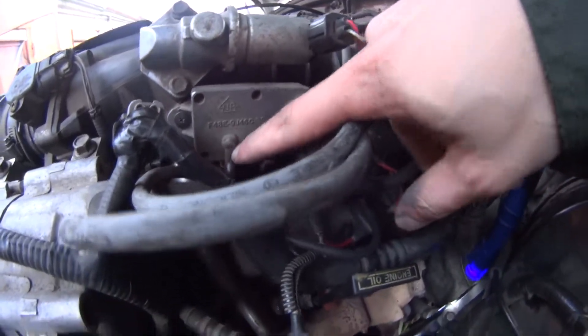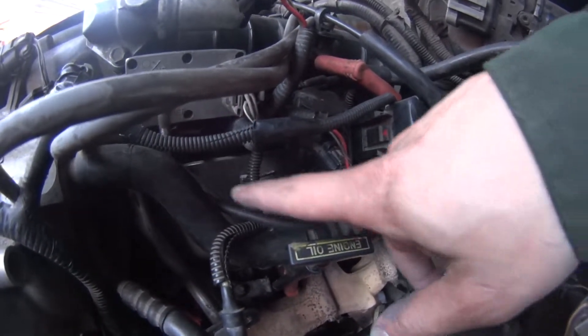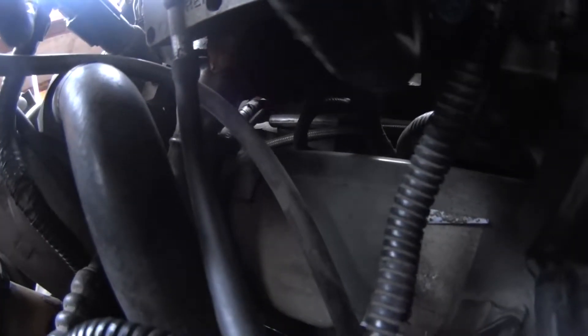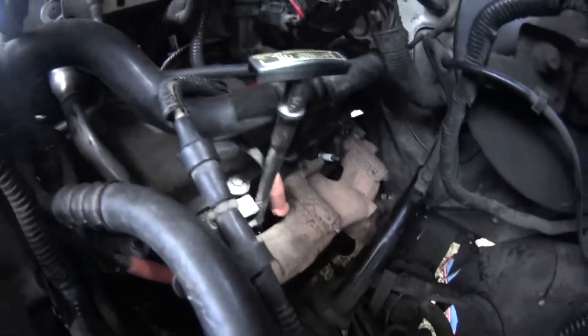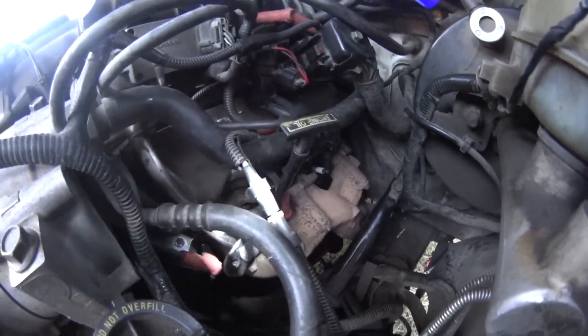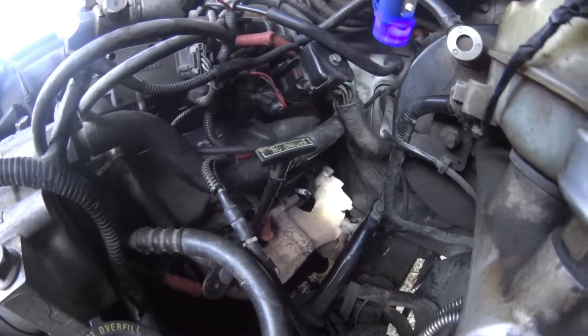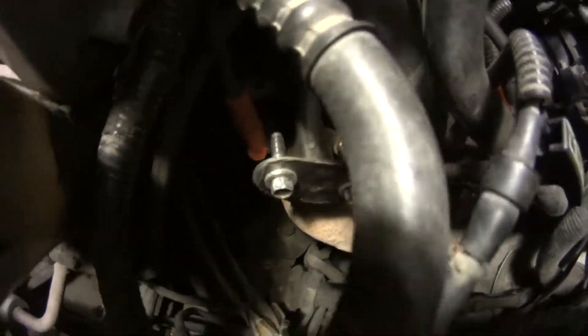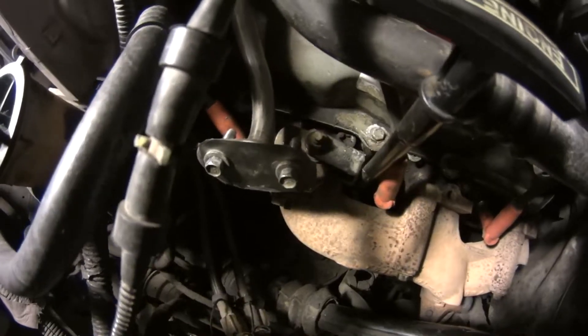Now we've sealed that big nasty hole. For the sensor: this closest thin pipe we connect by its hole to the vacuum line that previously was connected to the EGR vacuum valve, and the other big pipe we leave with no connection. The DPFE sensor will show no wrong data to the PCM whatsoever. Look how much spare room we have in the engine compartment now. To seal the intake hole, I made something like a gasket and put some RTV under it.